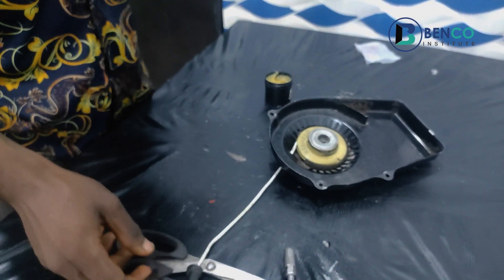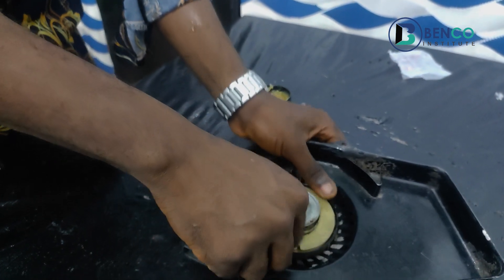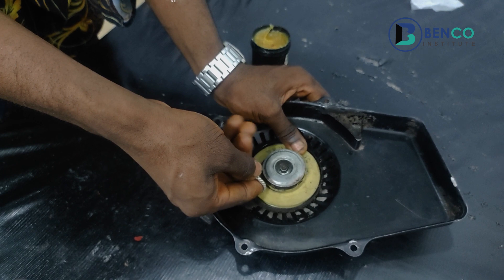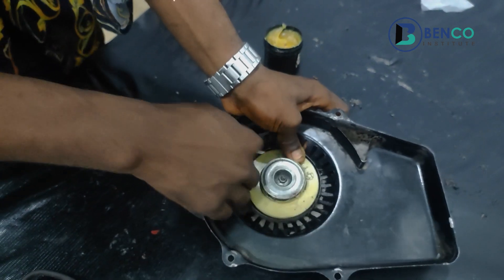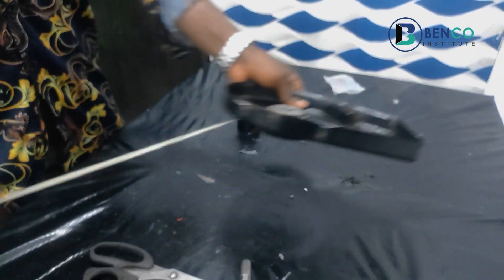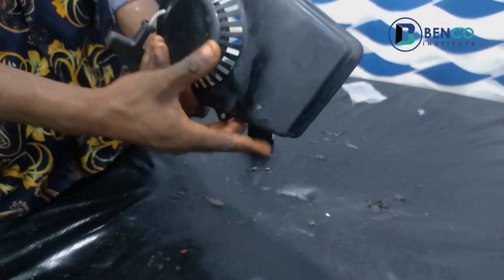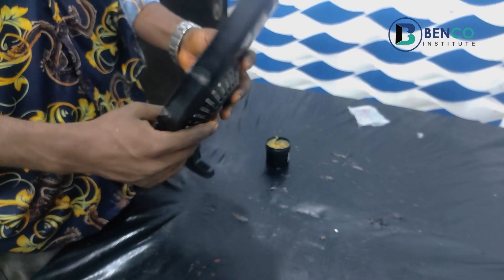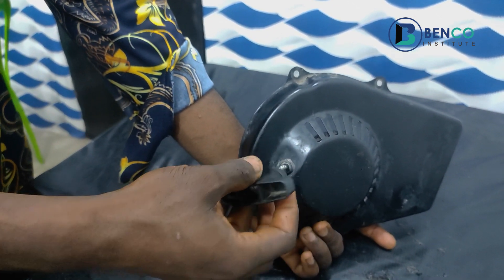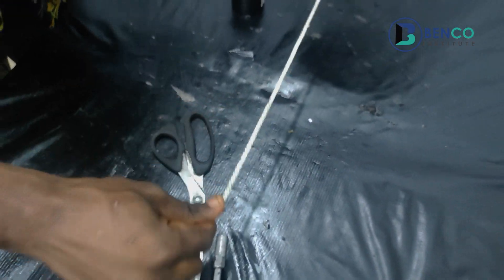There's a little issue — the entirety of the rope has not gone in. So we look for the hook again and rotate anti-clockwise, but this time just once, since the rope is quite short: once, and then we leave it. Now we've successfully assembled the starter from scratch and you can fix it to your TG950 generator. I noticed it hasn't entirely gone in, so we pull out a little and go one more time — there, that should do it.